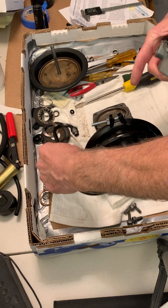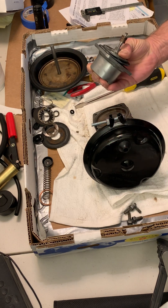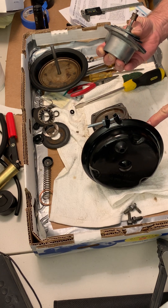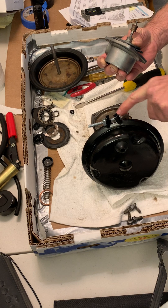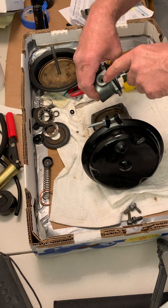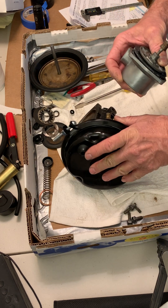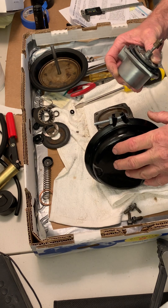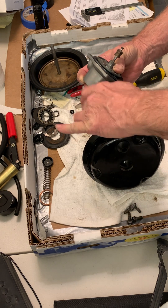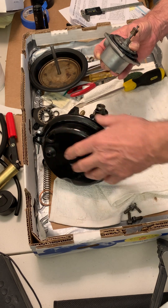So what we have when everything is in neutral position and assembled: vacuum comes in here, air gets pulled out of here, making this side full of vacuum, which pulls vacuum through here, fills this entire assembly with vacuum, and then through that pipe fills the other side of this vacuum chamber with vacuum. In the neutral position — vacuum, vacuum — nothing moves.